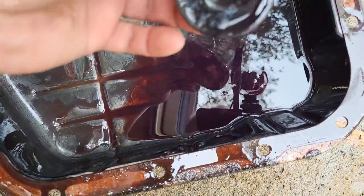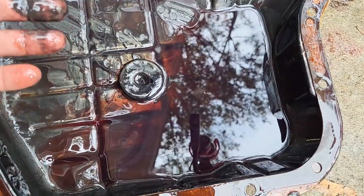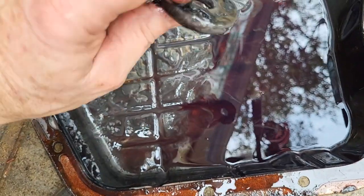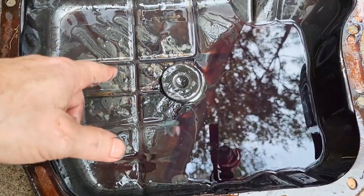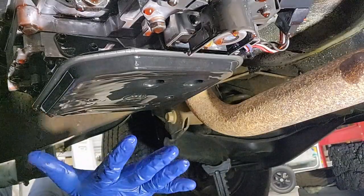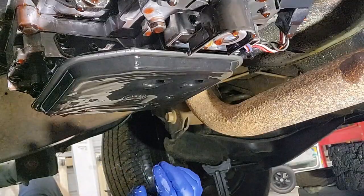There's some stuff on here, but wow, there's hardly anything. This tranny's in really good shape, which I figured — I don't have a tremendous amount of miles on this rebuild. It's been rebuilt, so I didn't think it was going to be terrible. It's just a shifting problem. I'm pretty sure it's one of the four sensors in there. We'll work on all those, and we're going to add a drain plug to this as well so future fluid changes will be much easier. I've got gloves on in an attempt to keep things as clean as possible.